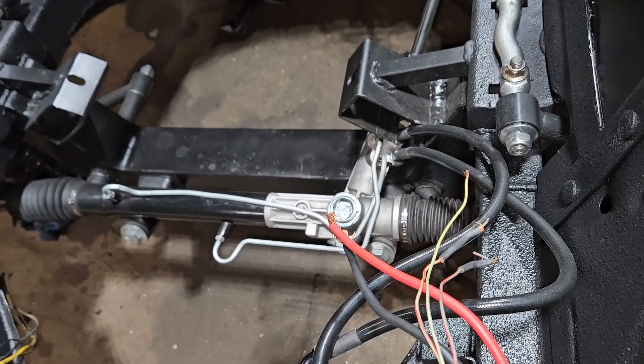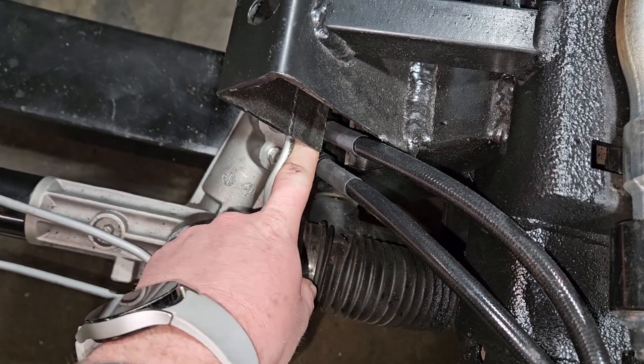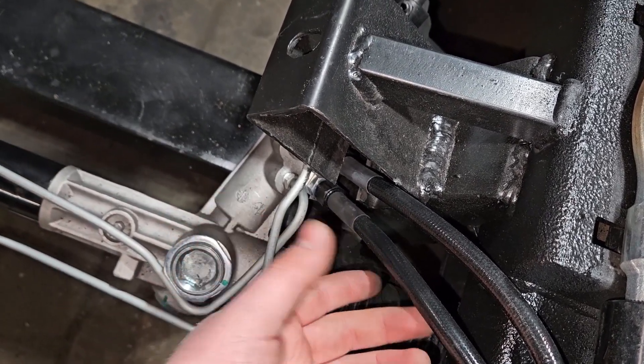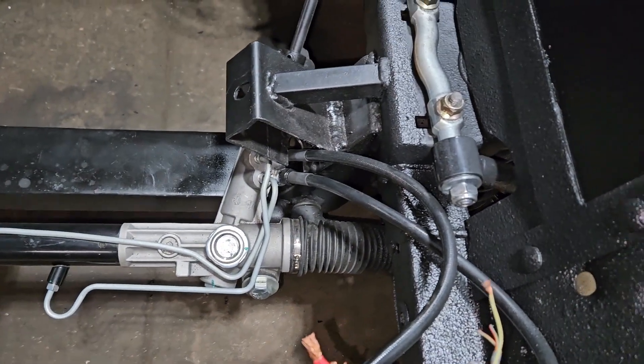We threw this on a battery — it works fine, sounds pretty cool. Also, another side note: if you're doing a Fox body rack or a Mustang two rack, the bottom fitting is your pressure side and the top one is your return. These are All-Star Performance off-the-shelf hoses, I think 18-inch and 24-inch — AN6 to AN6. The other fitting screws in here and adapts it. I did a lot of Googling and stressing over this. The biggest thing was the rack fittings — I bought both metric and standard and they both work.